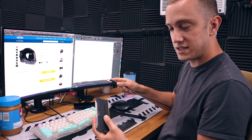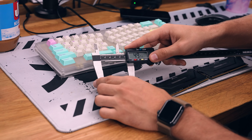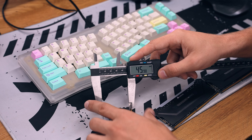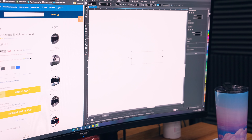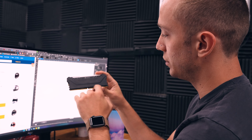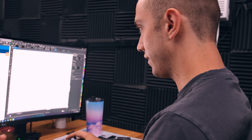First part, we're going to have to size the RAM up. We do have these calipers here. We want to get just the heat sink, but the issue is it's really tall, so we want to get all of it up to the LEDs — looking about 46 millimeters. Then we measure the length as well — about 138. So that's essentially our RAM stick. We're going to do a big square, and before we put it on the printer, we'll take some tape, mask off all the gold pins and the actual PCB itself. First time we're doing this, so we'll see how it works.